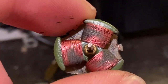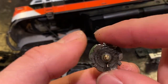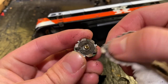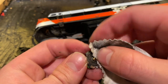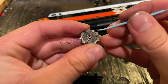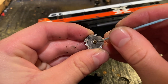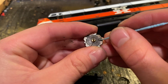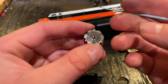It might still work for a while, but in all likelihood this is overheated pretty badly and could be burning. The commutator, other than the oil, actually does not look super bad. Let's check the gaps — in a lot of cases this is where smoke in a motor comes from. I'm not so sure that this is one of them just given how bad the coils look, but we'll try cleaning those out. It might make a difference, and it's not going to make it worse.